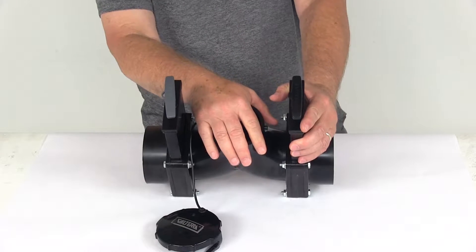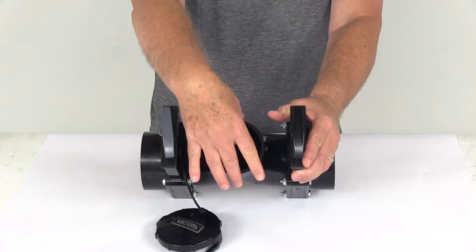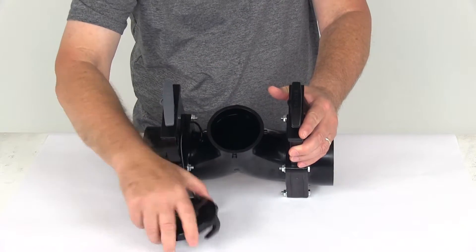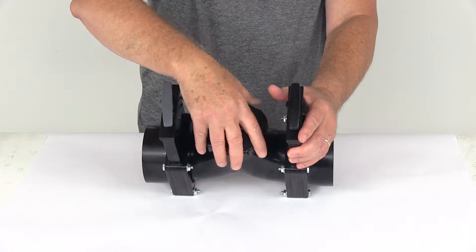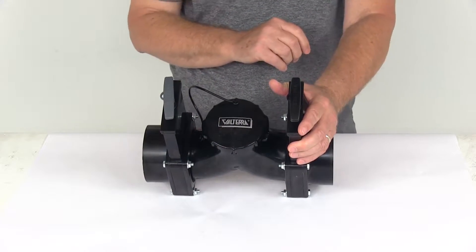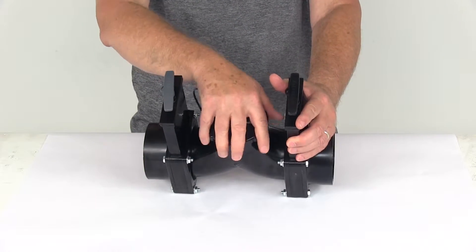This can also be connected to a drain hose with a bayonet fitting. The bayonet fitting basically means the tube has four pins on it, and the cap will either have two hooks or four hooks — you just twist it on there and it locks into place. Same way with a drain hose: the bayonet fitting would have two or four hooks to attach.